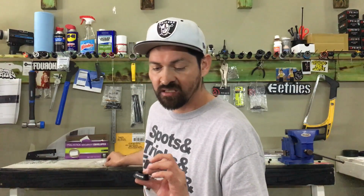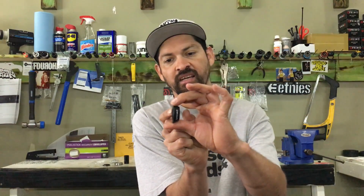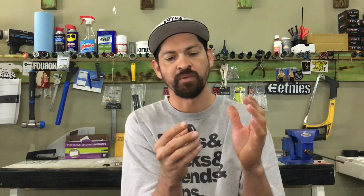On this one here, it's way thicker, like I said, to take up a bunch of the space, and that's because your sprocket, your hat washer, the little cone, or the little wafer washer in between is X amount. So when you match it up to this one here, then this one takes up the majority of the space, then your crank arm goes to the end.